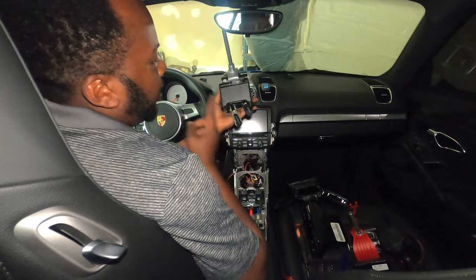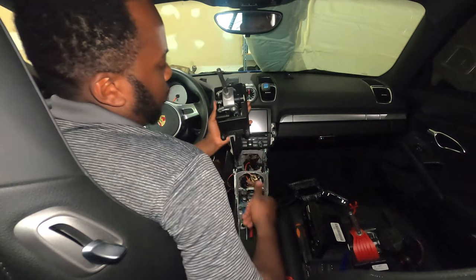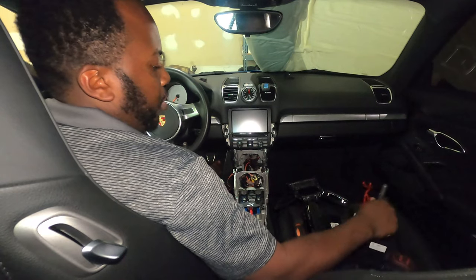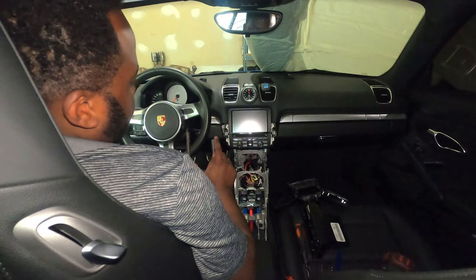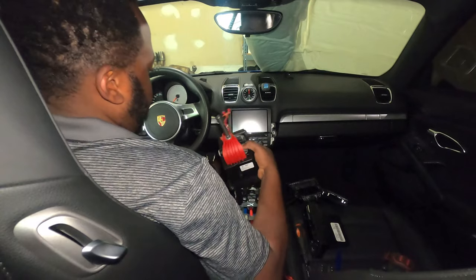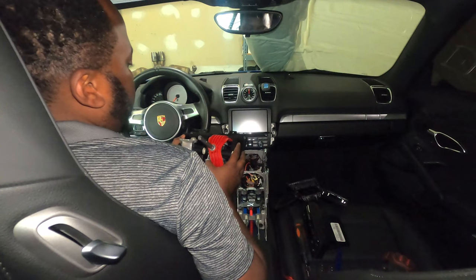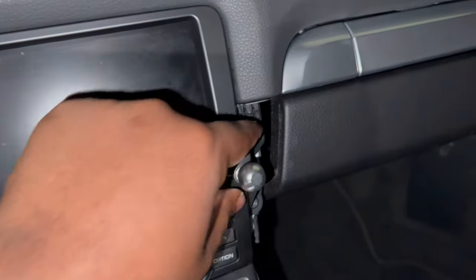This is the factory shifter. The white is always on the left and the black is on the right. The small side goes towards the back of the car, the wider side towards the front — and the part with the label faces up. I'll place it here to compare both. When you order the short shifter from Porsche, this is how it comes — it's a little shorter. The label should always be on top with the white on the correct side, so this is how it will install.